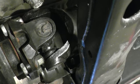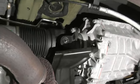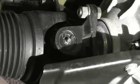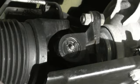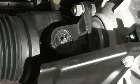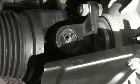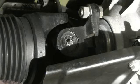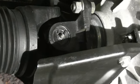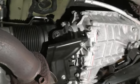Now this is the rear drive shaft. This is the reason I said you need to lift one wheel and put it in neutral — so you can rotate the drive shaft. If the fitting ends up either at the top or bottom you won't be able to grease it. You need neutral to spin the shaft, and one tire off the ground so it can rotate freely. This here is the front grease fitting for the rear drive shaft, next to the transfer case.